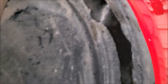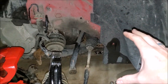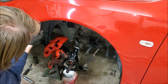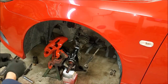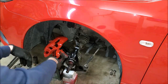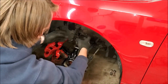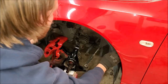I highly recommend that if you are able to get these out, put anti-seize on them when you put them back together. These six 8mm bolts are now removed — one right there, another two, one right there, one right there, a fourth up top, and five and six by the rocker panel — along with those 10mm studs that we unfortunately broke. Now we are ready to wrestle out this fender liner. It's relatively the same process with the strut in here because there's actually a cutout, so even with the strut it's not that bad.